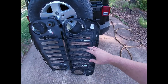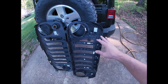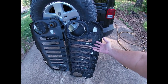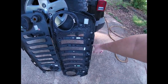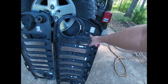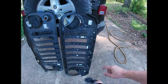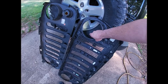So as you'll see in the video, the modifications you have to make — just to go over them real quick so you either know to turn off this video or keep watching — you'll want to have a Dremel with a plastic cutting bit. You're going to have to cut a lot off the sides, cut two of the clip holders off, modify the clip holders to clearance, and clearance a lot of the top up here. You'll also have to clearance these headlight bezels if you have a grill with this type. This is a Rubicon grill.